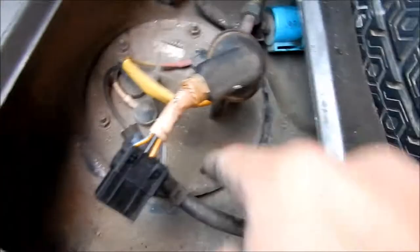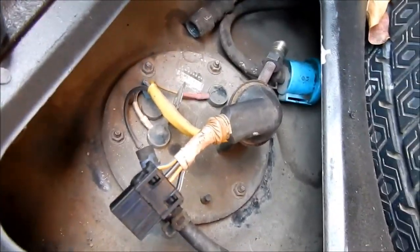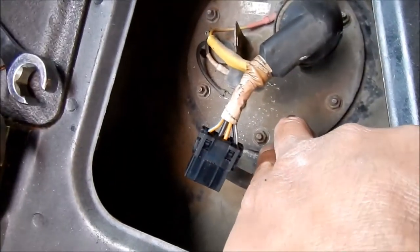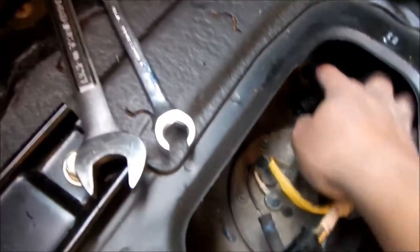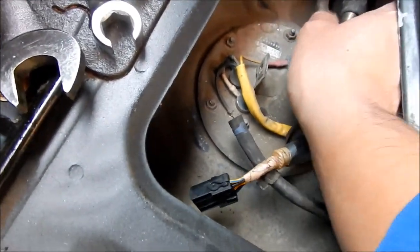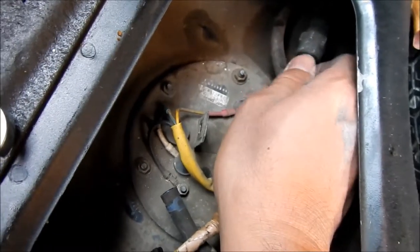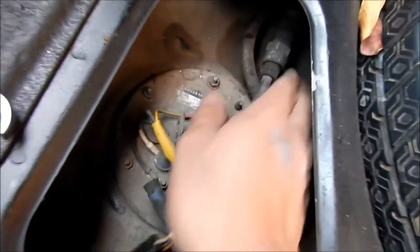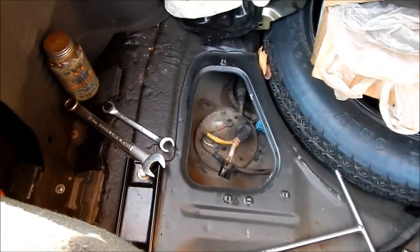The little nubs are sticking out all the way — that's good, that means the gasket is lined up properly and everything's in there. You can see this one is the only one that didn't quite line up properly because you can still see some of the clean area. Now we just connect our fuel line, so I'm just going to do hand-tight right now. Fortunately this Galant is in pretty good shape where the gas tank is, because some I've seen are really rusty. Now we'll go tighten it as tight as I can with the wrenches — not super duper tight.